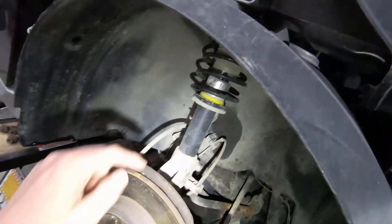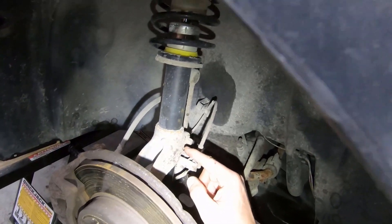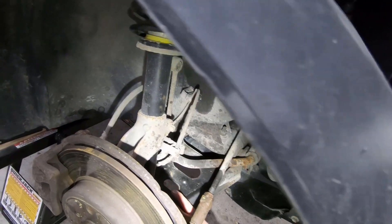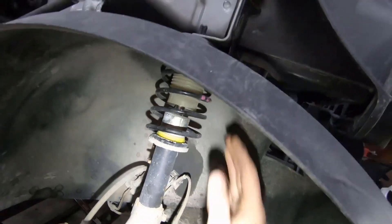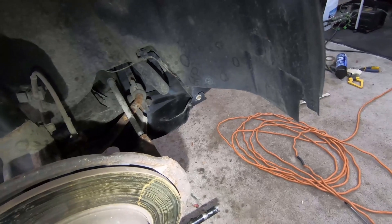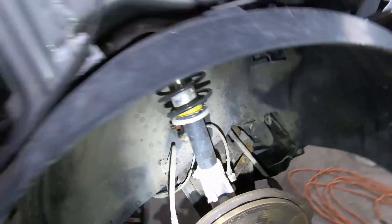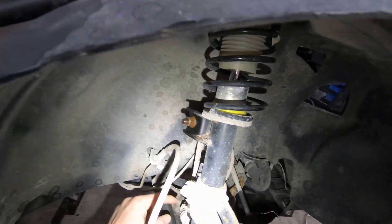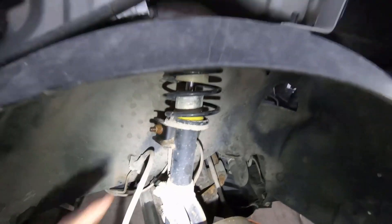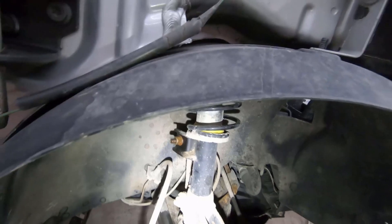It's a little bit of work to undo this. I'm going to show you how to remove this whole assembly. It is possible to slip the strut out of the knuckle, but it's a bit of a challenge, so instead I'm going to undo the lower ball joint and remove the whole assembly - same thing I'd do to replace the spring. I'll release the bottle jack and let that come down fully for extra room. I've already put penetrating lube on the bolt holding the sway bar link to the strut, which needs to come out so the strut is free.